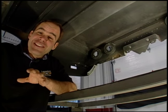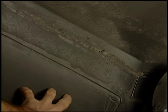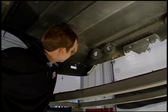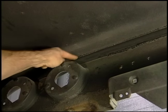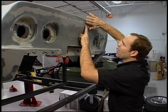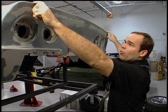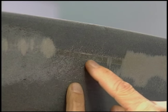It's not often you get a chance to actually see the bonding strips from underneath the car. You can clearly see here where the quarter panel — this is the bonding strip — and the deck lid panel lay over top of the bonding strip, and then there's a thin seam on the outside. Same thing with the tail light panel here. The tail light panel is one piece, the top of the deck panel is another piece, and they butt up against each other with a gap. Behind this whole section is the bonding strip, and that's exactly what it does — it bonds these two panels. This gap is filled with bonding adhesive or Vette fill.